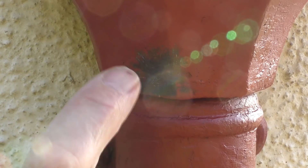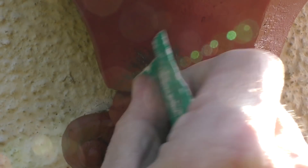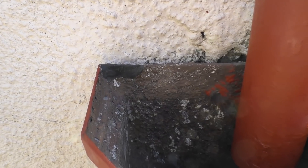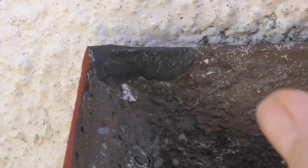It's about 36 hours since this repair was done. It's gone metal hard - you can see it leaves a scratch behind when I dig my nails into it. I'm just going to give it a light sand just to take that surface film off, and that's it. When I tap it nothing happens - it's a lovely rock hard repair. And not forgetting this little repair here - it's also metal hard now. I'll give it a brief sand and get it painted.